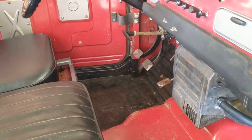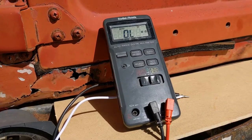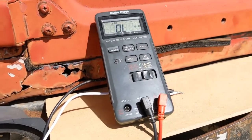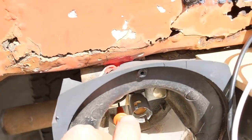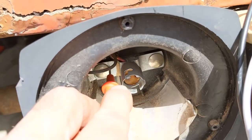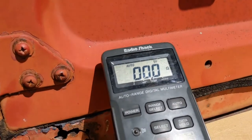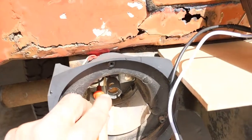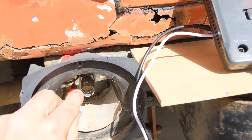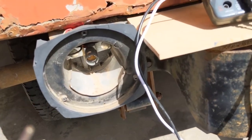The electricity from the cab goes through the ground wire back to the battery. Next stop is the back of the vehicle. I've got my test wire connected to the ohmmeter lead and I'm touching it inside the light socket where we're getting low voltage. The answer is zero — that means we have a good ground connection from this light all the way back to the battery. Grounds are good, so it's not that. I have another idea for the next test.